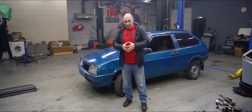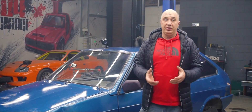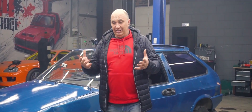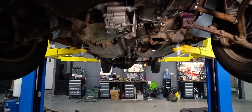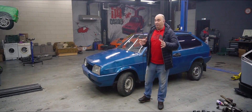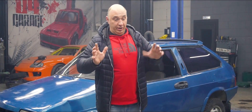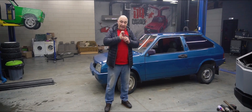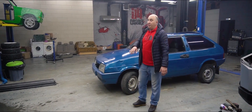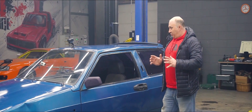Now, you guys do remember what sort of four-wheel drive configuration we're running, right? It's basically a full-time system with all four wheels spinning at the same rate. I do remember someone asking in the comments whether we calculated the transmission ratios — indeed, we did, so don't you worry about that. We rolled it around after putting it together, and at a quick glance it looks like all four wheels are rotating evenly, no slippage or anything like that. We rolled it over a wet surface and saw that the tires leave perfect tread marks, so it doesn't look like we have any problems with the transmission ratios.